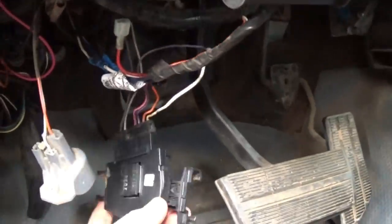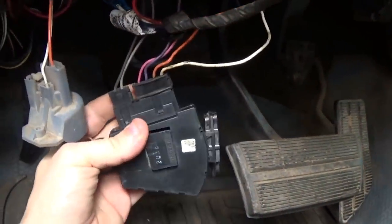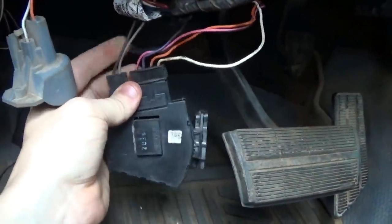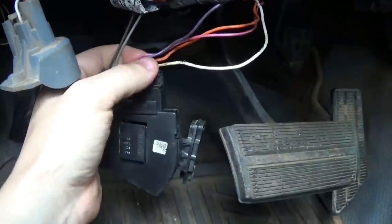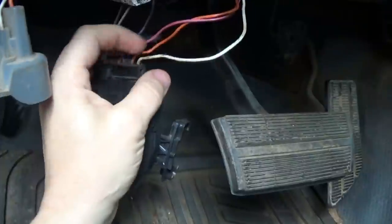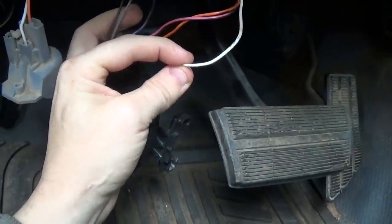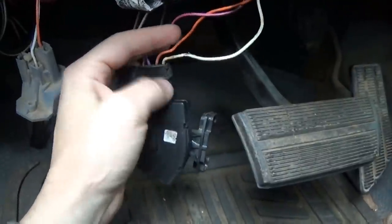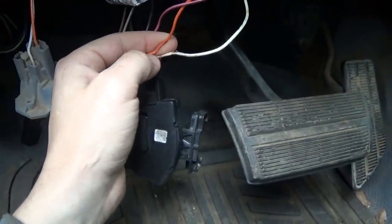Okay, so last time I was in here, we found out that the brake switch is good. Got three different switches in it. Thanks to some commenters, kind of helped clarify. One of these is to cancel the cruise control. The other goes to the transmission for some reason. And then, of course, the brake lights. So we applied power to this wire and it turned the brake lights on. So, since these are all separate switches, I can only assume that this is supposed to have positive coming in